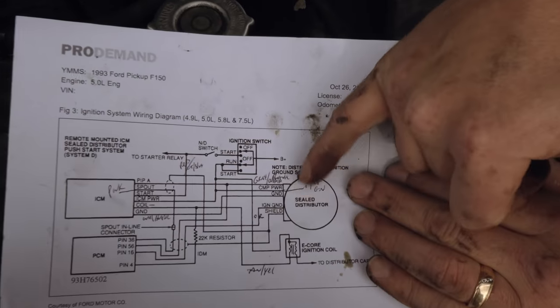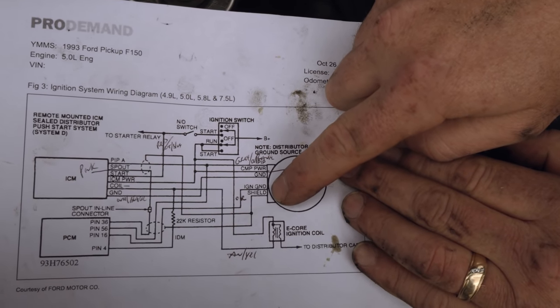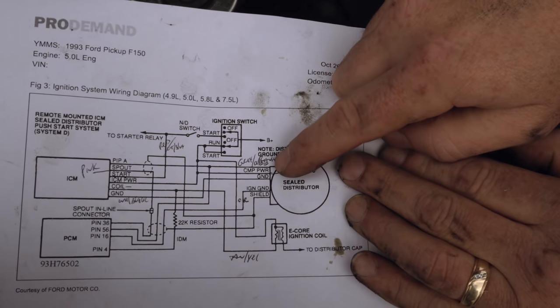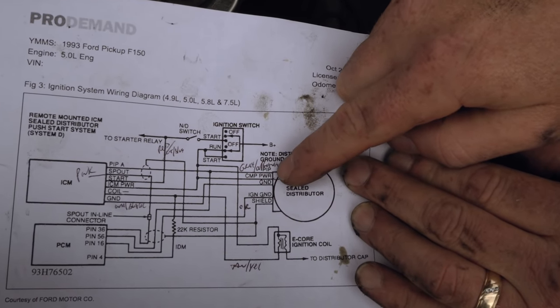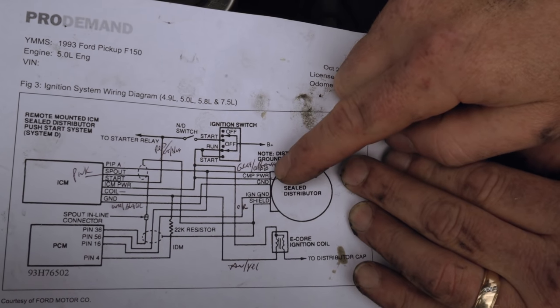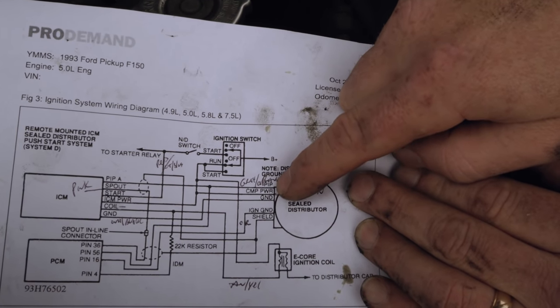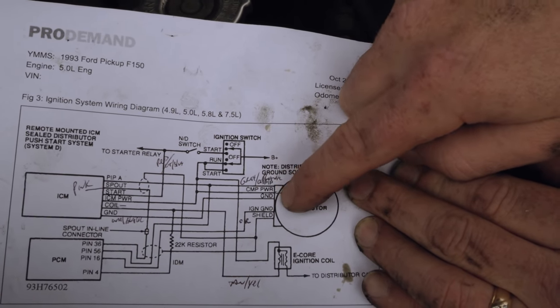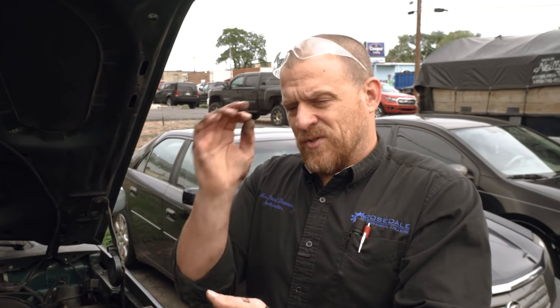When we're talking about what's in the distributor, they're showing an ignition ground and a shield — those are grounds, so it grounds in the housing. Then you have your PIP wire, which is your signal wire for the Hall effect. And then CMP power — camshaft position, but that's your power — and then ground. So the Hall effect signal is PIP, plus power and ground. When it comes to this working now after we did the PIP test — me giving it a signal — that just proves our fault is in that Hall effect pickup. So it needs a distributor pickup.